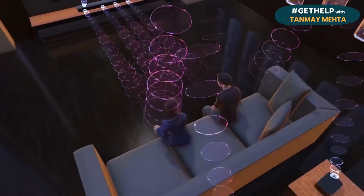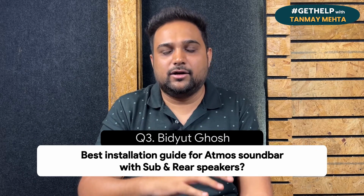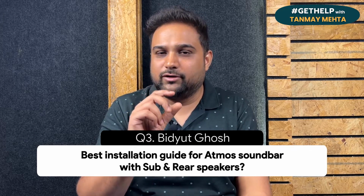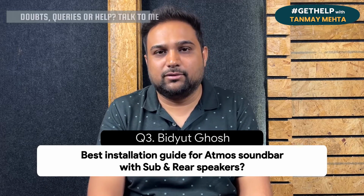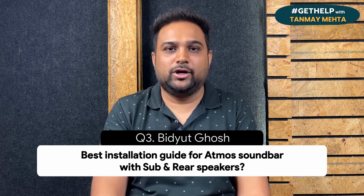With regards to the woofer, most of the surround soundbars or the Dolby Atmos soundbars comes with a wireless subwoofer. Now what does this wireless subwoofer do? Well, it's a simple subwoofer box which has to be placed on the floor. It can be underneath the sofa, next to the sofa, in front of your front wall or any of the corners of the room. So within the same room and on the floor is a mandatory thing for placing the subwoofer, and you need to just give it a power adapter. So wherever you have got a socket on the floor or near the floor, please place the subwoofer over there and pair it directly with the soundbar. You don't have to lay any single cable to it.